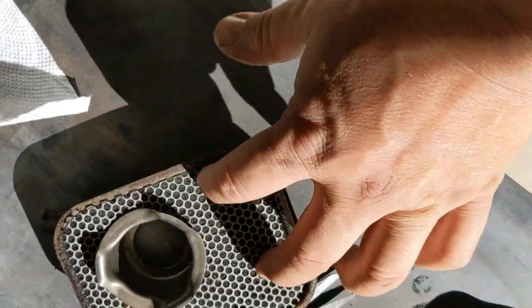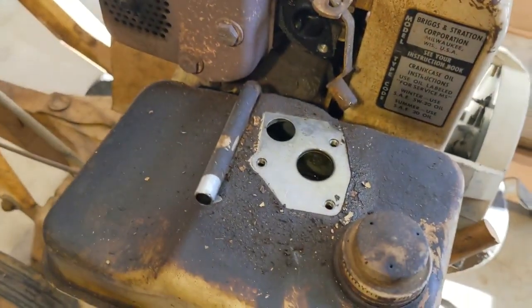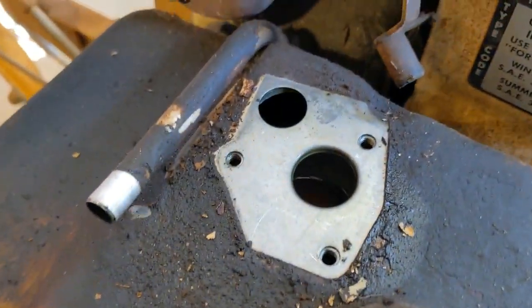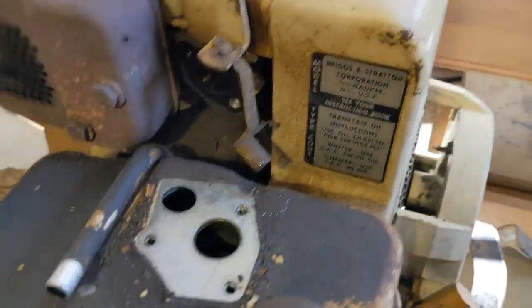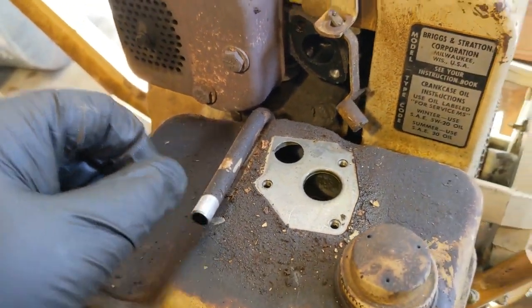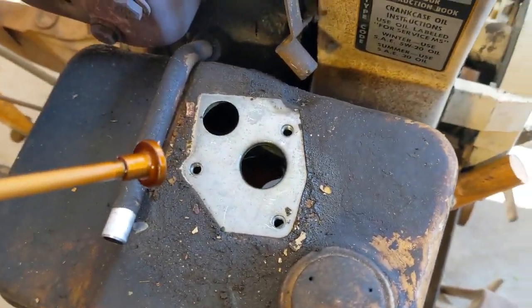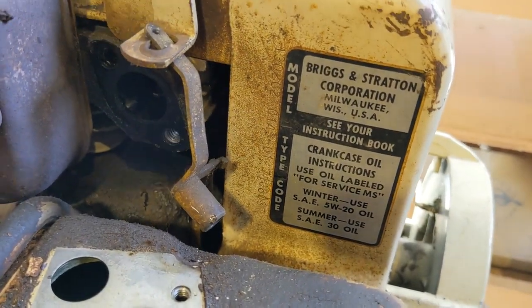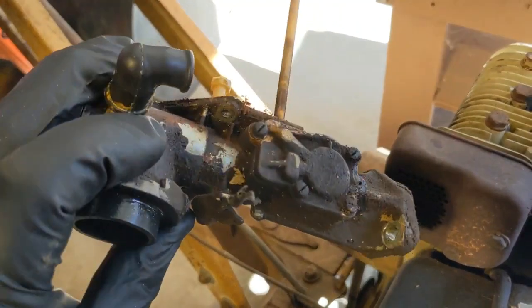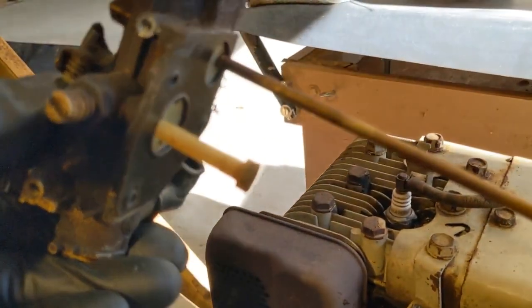That's left over from one of my mom's medical filters - open cell foam works just fine. Now it's all over but the screaming - the gaskets came off pretty much intact, so that'll be relatively easy. There's way more fuel in there than I thought. This must be the pulse tube from the engine to run the little fuel pump. Here's the rest of it - it pulls out pretty easy. Three screws and two bolts on the engine, one of them in an impossible position to reach, but it's doable. There it is - we'll take that over to the bench and get it cleaned up.